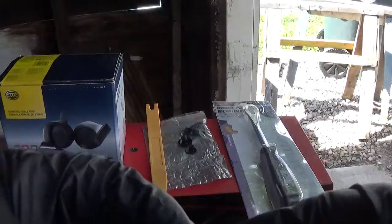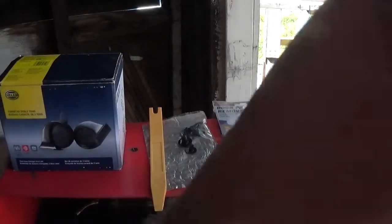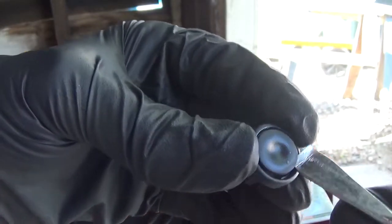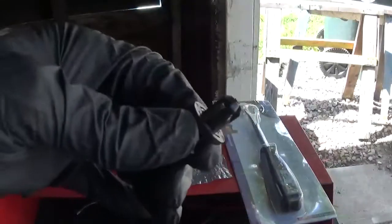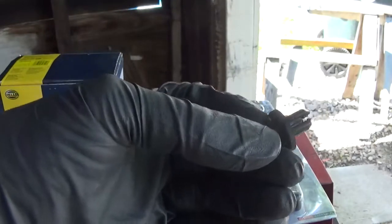This is the first type — it's a push pin clip. When it's seated, the top pin is in and it spreads out. To undo these clips, I've found that this little paint tool is excellent. You just get the corner in there, lift up, go around, and then you can pull the top out and the clip will be released. Turning it half a turn while you're releasing it helps. Generally doing it this way you don't break these clips, although they're like 50 cents each — they're cheap.